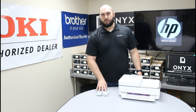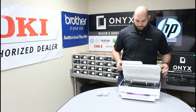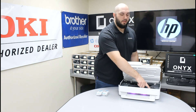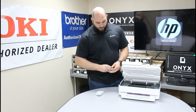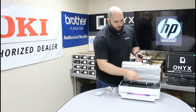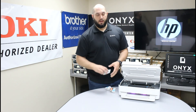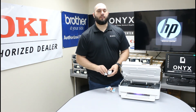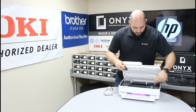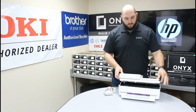All we have left is to go ahead and install our ink. We're going to find those handles at the front sides of the printer again and lift the cover up. Once you do that you'll see the printhead actually move so that it lines up with two little marks on the front side of the printer. Now open up your ink cartridges. Remember to always remove the little protectant seal. Make sure your color ink goes in the slot for color and the black ink goes in the slot for black — they're color coded. One has a purple tab for color, one has a black tab for black. Remove the protectant seal, lift the tab, and install the ink. Once the ink is installed you can go ahead and lower that cover.